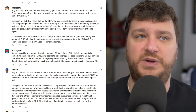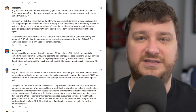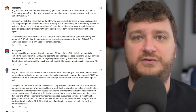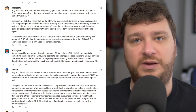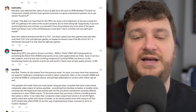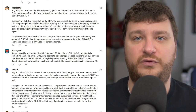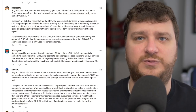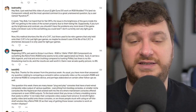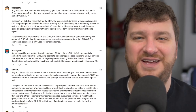I don't know if that's true or not, and I no longer have access to any flat glass CRTs. My guess would be no — anybody that tested that probably had a flat glass CRT that sometimes worked and sometimes didn't, which is very common. As the image gets closer to the flat edges, it won't work anymore, and I think it has more to do with reflection of light than anything else. My personal collection is concentrating only on curved tube CRTs, so unfortunately I'll have to leave this one to other people to test.